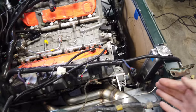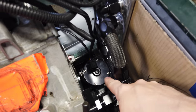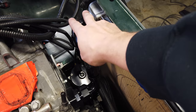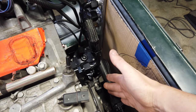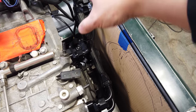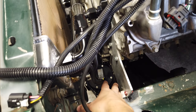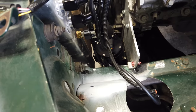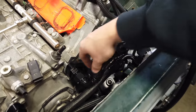Up front on Clyde, I ended up getting the alternator all finished up and mounted, the water pump and everything is installed. The electric water pump — the big Meziere 55-gallon-a-minute pump — is over there, all installed. Put two bungs here; these are dash-12s and then the bottom is a dash-16 that comes off the pump. The pump is extremely tight in the engine bay, just barely clears the engine plate and the radiator as well. Super tight — I'm hoping this isn't an issue, but everything seemed to kind of work out.